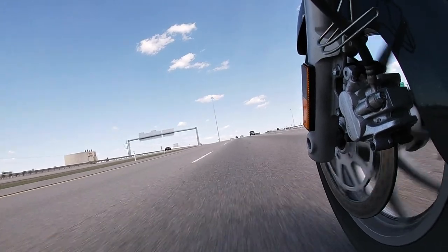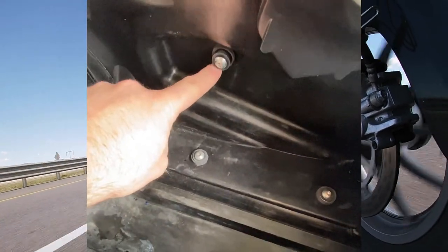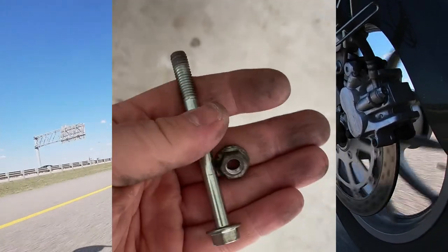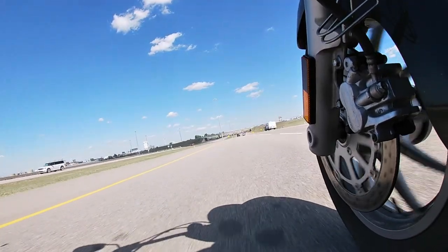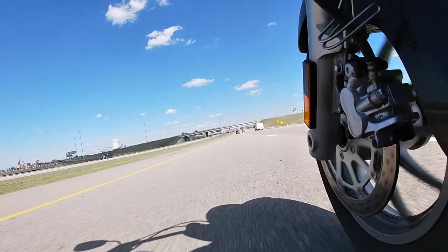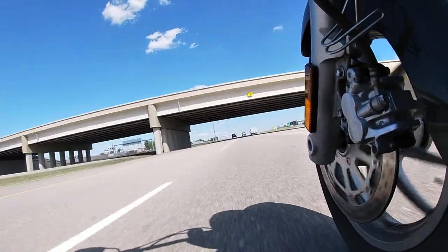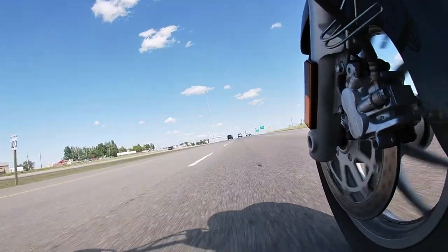Keep in mind that Suzuki is Japanese and as such uses the metric system. You'll notice four hex bolts - those are all that hold your saddlebag to the saddlebag frame. The bolts on the vertical wall closest to the tail have a loose nut behind them, meaning the nut is not welded to the fender. Each one of these bolts also has a washer and a spacer - don't lose them. When you've got the saddlebags removed, use a 12 millimeter socket to remove the saddlebag brackets. The muffler side - that's the right side of the bike if you're sitting on it - has a heat shield attached, but you don't need to remove the heat shield for this.